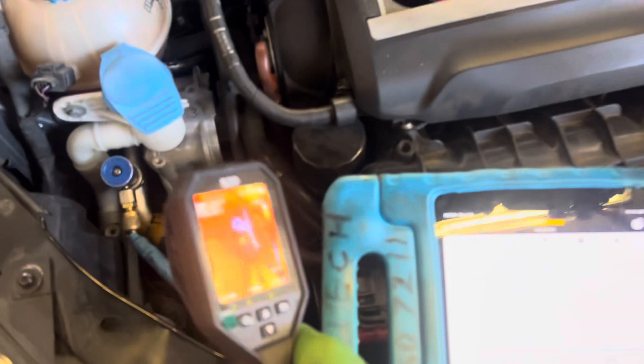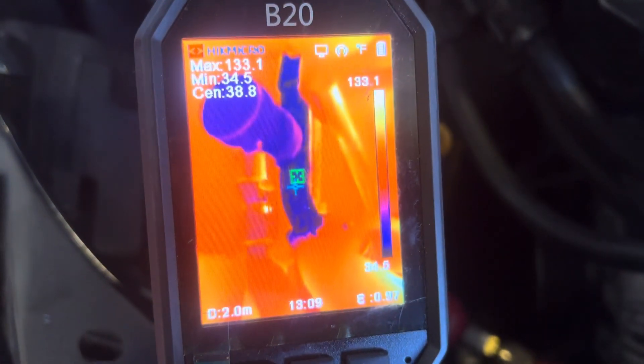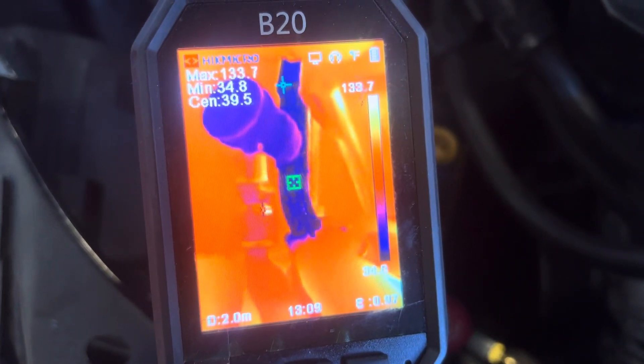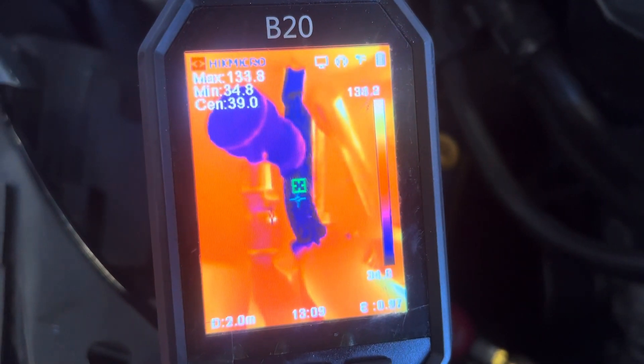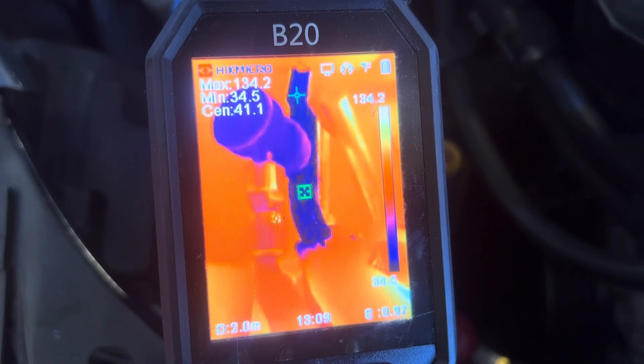Let's take a look down here. Let me zoom in so you can get a focus on this. Our temperature — 34 degrees. That's the coldest temperature you see, reading somewhere around 38, 34. See that minimum temperature jumping around? That's the temperature of the evaporator. When your evaporator is that cold, you should have a lot of condensation. Did it start leaking condensation under the car? We're just starting right now — there's some drops, a little wet spot right there in the center.